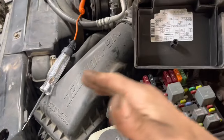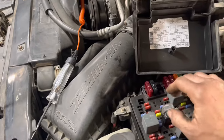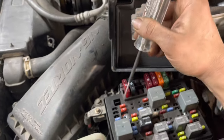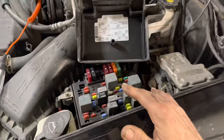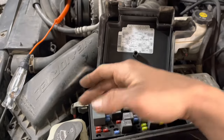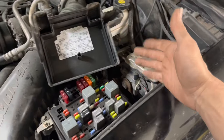In my situation the ignition switch was getting hot on the inside and dropping out the 12-volt power supply, even though I couldn't tell. If you go down to a local parts store and spend five or ten bucks on a test light, you test that power and it doesn't have power while it's cranking, then you know you could just run a wire from something that always has power. The reason that's not the best way to do it is because whatever is broken — which happens to be the electrical portion of the ignition — it's possible there's a wire broken somewhere else that could be grounded out, causing big problems. But more than likely, 99% of the time, we're going to conclude that the ignition switch is bad.